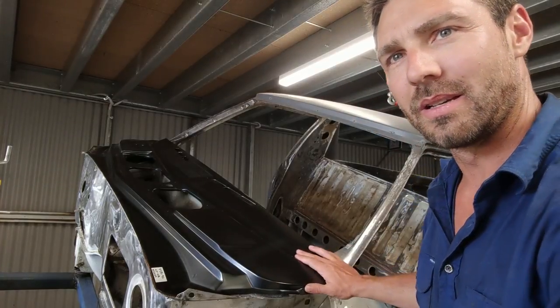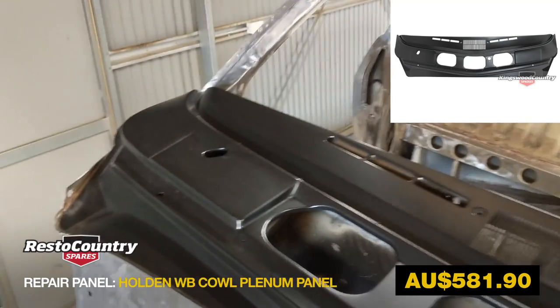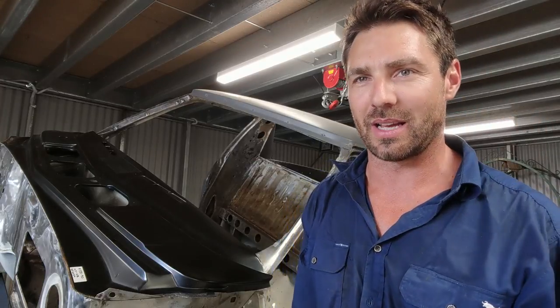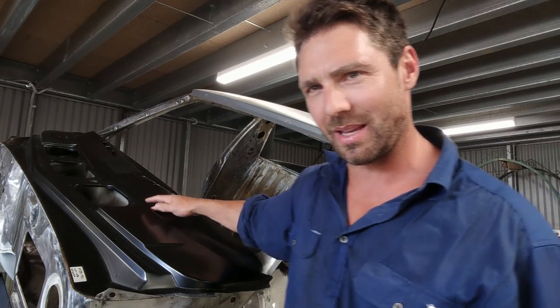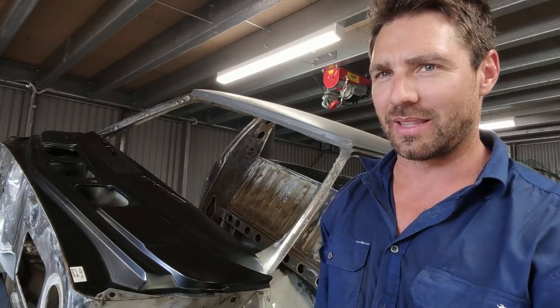Next is the actual cowl panel. Here it is — just literally sitting on top of the chamber work that I've done. Without much work at all, it's pretty much 95% of where the original one was. That clearly shows me it's moulded from an original mould and pressed straight out. Very happy with it. It's not going to require too much work to fit around the windscreen areas. These little sections here and the fabrications along there were my main concerns. It's sitting a little bit high — I've isolated it and it seems to be hitting a bit up here. It's just a matter of pushing down the plenum chamber where I fabricated — I think it's just sitting a bit high there.